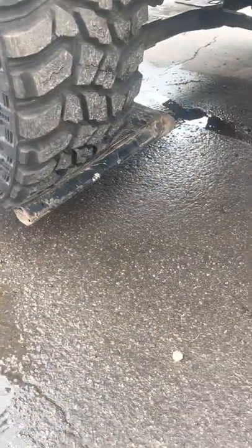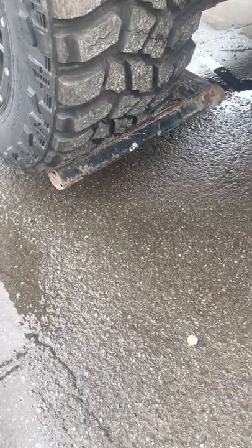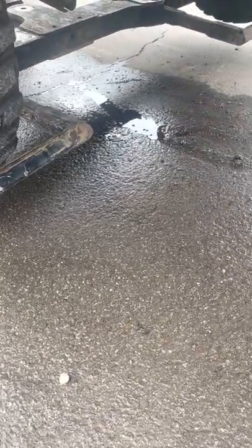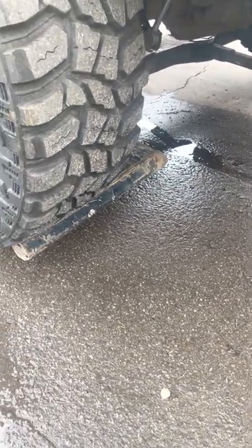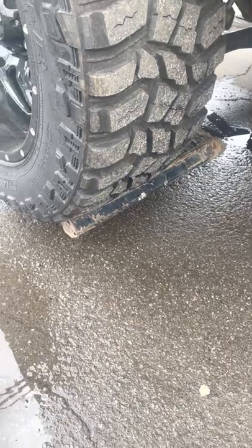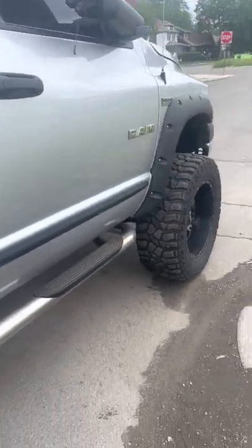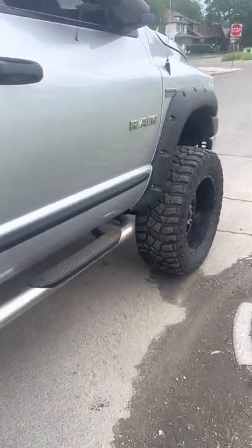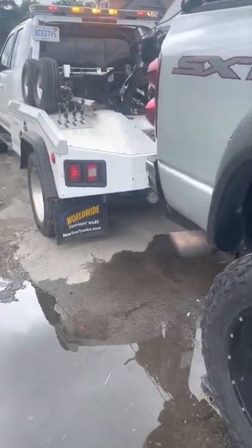I got it on the boom but you can see the tires are sticking out a little bit. I'm not going far with this one, just a couple blocks. But I'd advise when towing a car like this without dollies — the dollies wouldn't fit anyway, and it's just too much weight for the dollies with the truck tires and everything. You can tow it this way though; I've done it thousands of times with the repo truck.